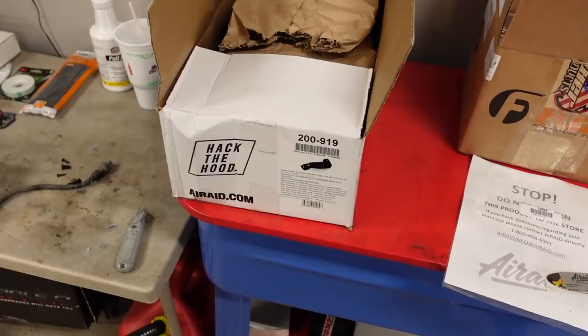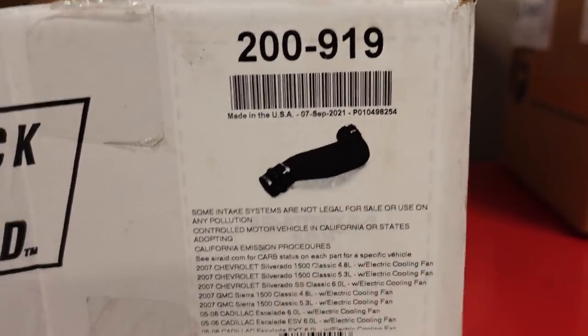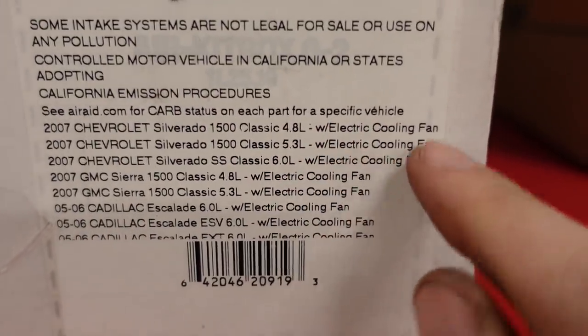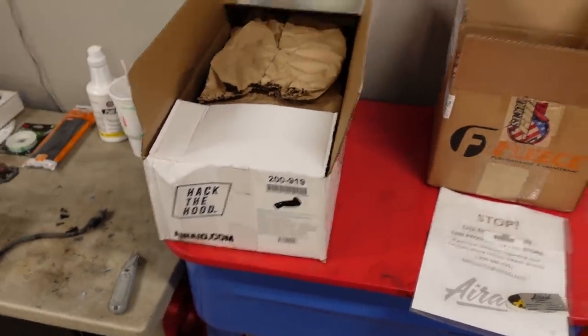And then we have an intake tube over here to replace the stock one. That's the part number there. I'll put a link in the description, but this is for a later model truck with electric cooling fans. This is just gonna flow a little more air than stock, and it eliminates those big bulky resonators on the factory tube. So it'll make it sound cooler and flow just a little bit more.